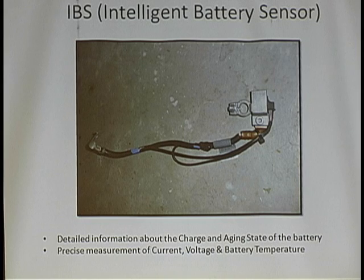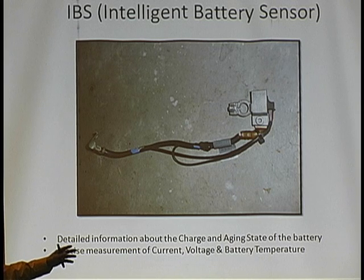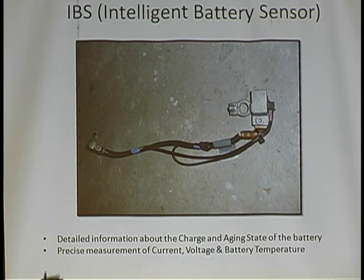When you change a battery on a BMW, you have to re-register it. If you just put in a new battery without registering it, it'll get destroyed — the system doesn't know the age of the new battery; it thinks it's the old one. So now there's a whole new thing in the mix: power feed, ground feed, and wake-up call — either through this system or through ignition.